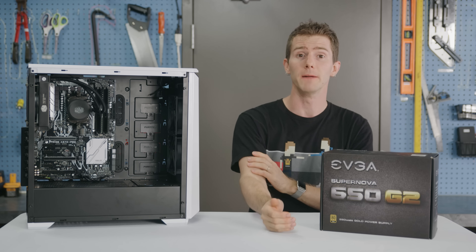When it comes to storage, there are a couple of approaches to getting the best value. Optane is not available for AMD at this time, so we went with a Western Digital Blue internal SSD. The 250GB SKU at under 100 bucks is probably your best bet. Then for another $50, you can get another terabyte of hard drive space for your Steam library. Slide the SSD sled upward to detach it from the case, mount the SSD by screwing four fasteners through the side of the sled, connect the SATA power cable, and route the data cable through the grommet, attaching the right-angle end to the motherboard.